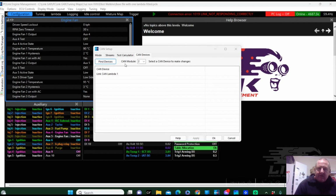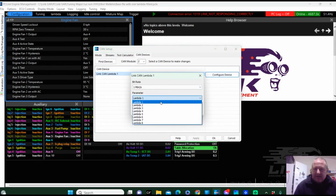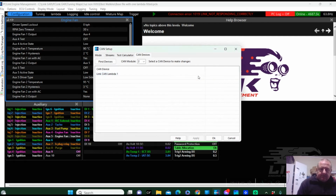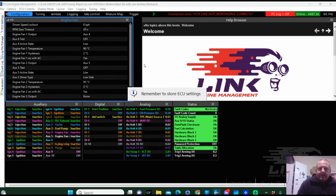Right, so I've gone in here now, and I've got it unplugged, and I've gone find devices, and it finds a CAN lambda. And so I'm going to configure this device, and I'm going to call it lambda 2. I'm going to send that. I'm going to cycle the power to the CAN device. And done there. And push OK. Store that to the ECU.